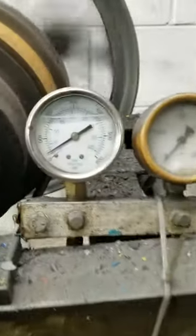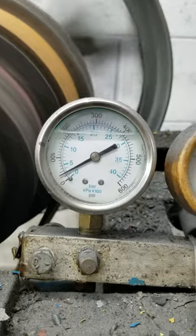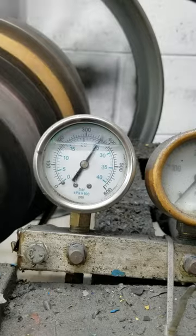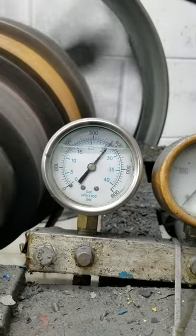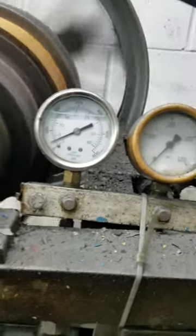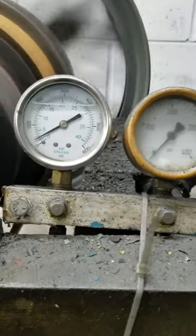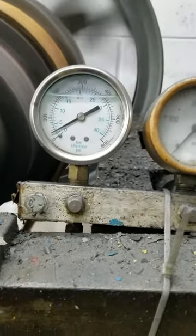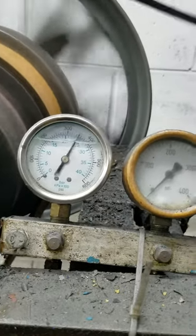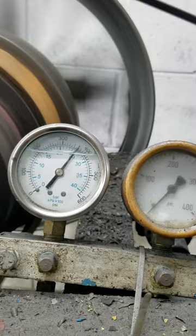Neutral pressure of course is perfect. In a gear position it starts out good and then it starts slowly walking down. Neutral pressure again looks fine, but now we're under 350 — or just a little above 350 — which is a problem.